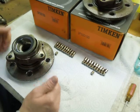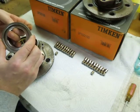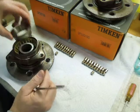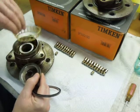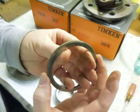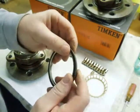I got this stacked up basically the way it came apart. This is the seal that seals the inner bearing race to the hub itself. In here, if the bearing was down in there, you'd have all the rolling elements going around in here. And that's the cage that goes with that bearing. This seal is a two-piece design. The actual sealing surface is down inside here, and I'll show you that.